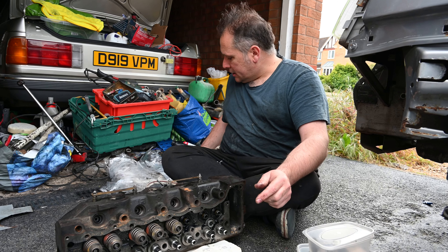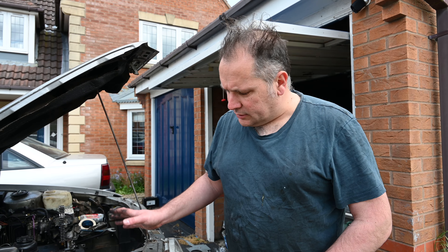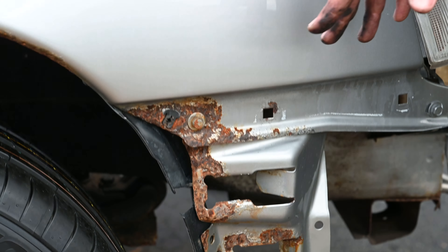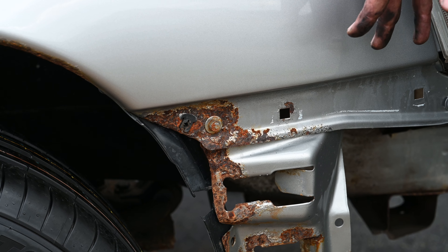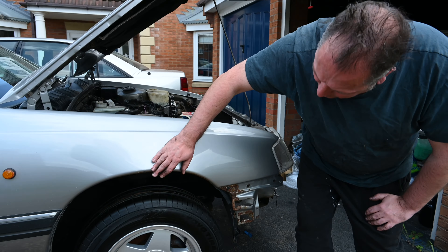Hopefully the rest will be fairly straightforward now I've got the technique. Now the next thing — I think this is going to be time consuming. This side has been repaired prior to our ownership and they did a fair to middling job. Because you always have to compromise somewhere, the finish is reasonable enough. But if we look under here you can see there is a lot of rust. I suspect what caused it is it had some rust originally, when it was repaired they took out the inner lining and then didn't use epoxy primer on the metal. Epoxy primer is a very high adhesion primer, and without that what happens is water seeps from the undersurface and over time it creeps round and doesn't stick properly.